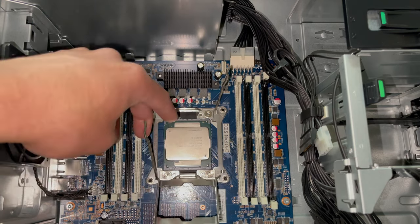As you can see, this is our 512 gigabyte SSD here. So I'm going to go ahead and erase that. I'm going to use APFS here. I'm just going to call it SSD. APFS with GUID, standard stuff. It's going to finish fairly quickly here. And I'm just going to go ahead and confirm with View, Show All Devices that everything's properly set up.